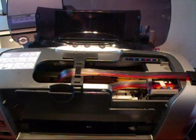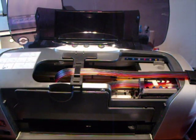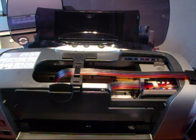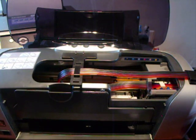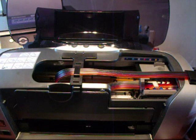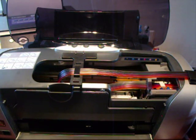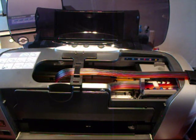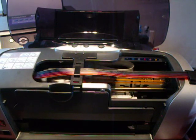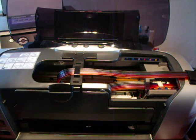All we've got to do now is see if the cartridges are recognized. To initiate recognition, press the red button up here — it has the red light on. Press this button and it'll go through the procedure as if you've just put in brand new cartridges — which you have really, just with piping attached to them. You can hear it's recognized the cartridges and it's charging them up, going through its normal procedure as if you'd put new Epsons in.